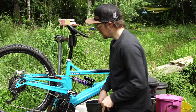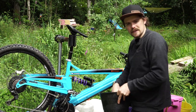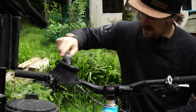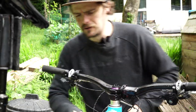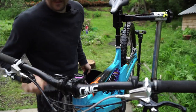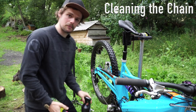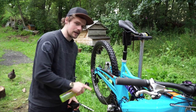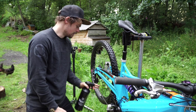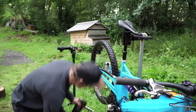When you're washing your e-bike, refrain from using the jet wash on the motor and electronics. A bucket of soapy water will do just fine — no need to force water into the clever bits. It's obviously waterproof, but a high-powered jet wash won't do anyone any favours. Lovely and clean. Another important thing when washing your e-bike is to pay extra attention to the drivetrain. It will wear out quicker than a normal bike just from the extra power the motor gives you, but keeping it sparkling will stay on top of this. Swap a degreaser on there.